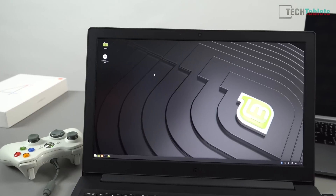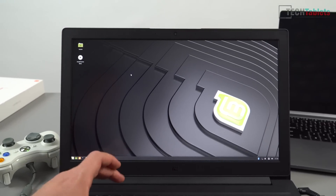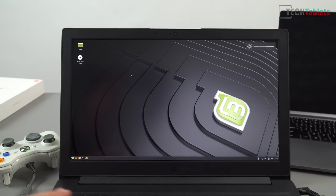For those who like to run Linux, it runs fine — screen brightness control, sound, and the touchpad all work. However, the wireless card does not work; it doesn't like the Realtek wireless card. The good thing is you can swap it out and use one of the Intel ones, which should be picked up by the drivers.